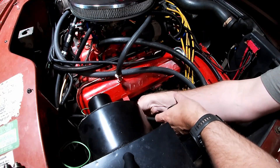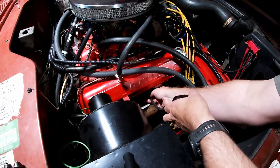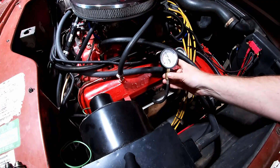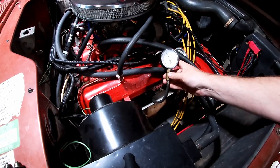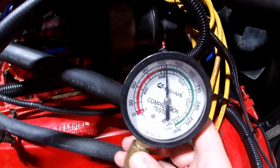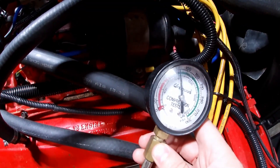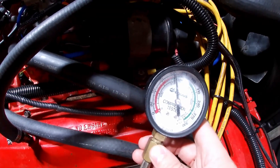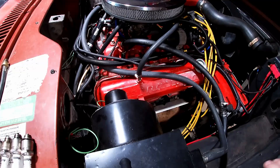Let's go back and check four again. It's coming in right between 125 and 130, slightly more toward 130 — so maybe like 126, 127. I've checked all the ones on this side and they're all good, all in that range. There's not that much variation — we're talking like three to four pounds max so far on this side. Let's check the other side and see what's going on over there, starting with number one.